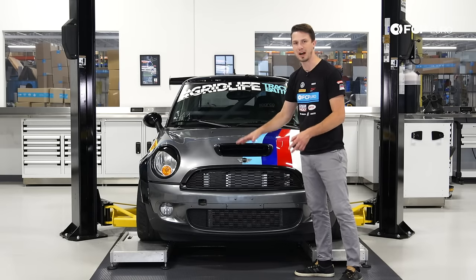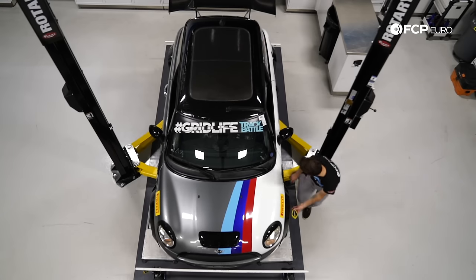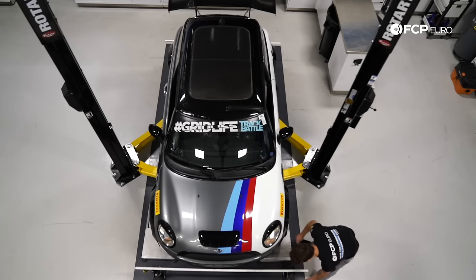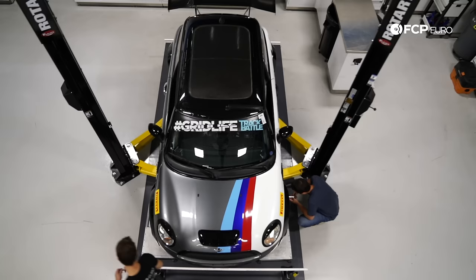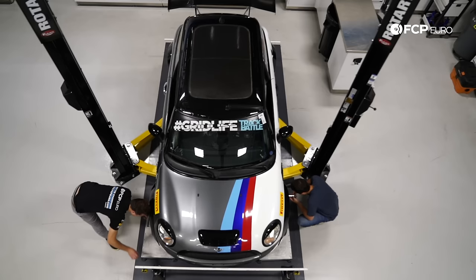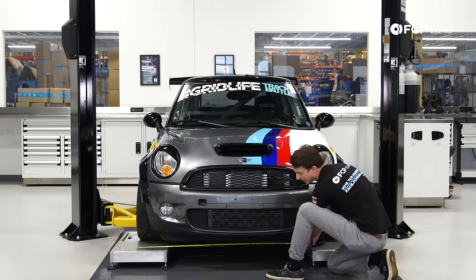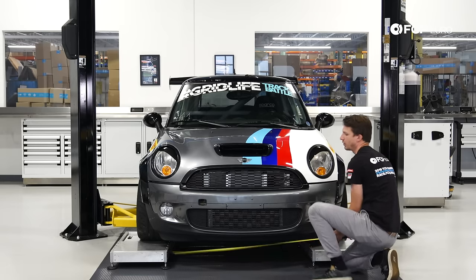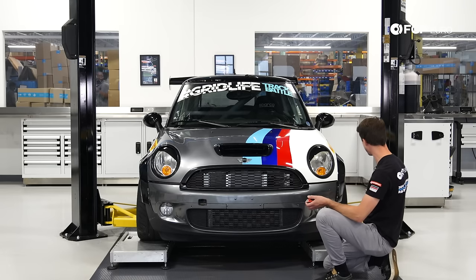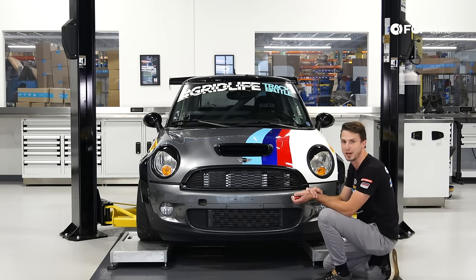The first thing we're going to do to set up the box around the car is measure the track width. We'll use two PVC pipes to create two parallel bars that sit in front and behind the car, with the exact same distance between the notches on each bar. I'm going to go from the outside of the left front wheel to the outside of the right front wheel—this is about a 70-inch track width. Taking that 70 inches, we add about 5 inches per side to let the bars stick out, giving us about 80 inches. We're going to cut our PVC pipes to about 80 inches. We have Schedule 40 three-quarter inch drain pipe from Lowe's or Home Depot, about $4 a length, so roughly $8 worth of pipe. We'll cut these around 84 inches to give a little buffer.